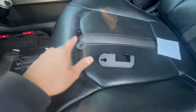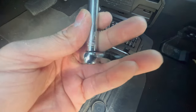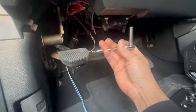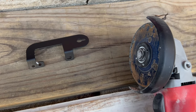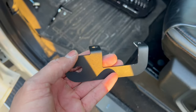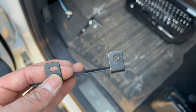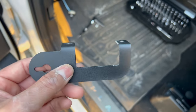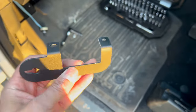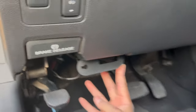Inside, all we need is the bracket, the face plate, the knob, the little allen key, and a quarter-inch drive ratchet with an 8-millimeter socket for these bolts. For my bracket I had to cut it straight down because it gets in the way of the OBD connector. After grinding it I took a file and filed down the corners so you don't cut yourself later. I took some permanent marker and painted that edge in there since I'm picky. We'll put the nuts back in there and your switch mounts right there.